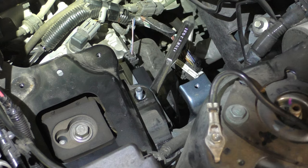Now that the engine mount is re-secured, it's time to slide the battery box back in. Just like before, we put the back in first and then maneuver and finagle all of these cables to get it all the way down. Now that the battery box is in, use the three 10mm screws to secure it — those get torqued to 15 Newton-meters or 11 foot-pounds.